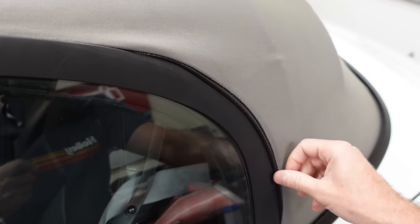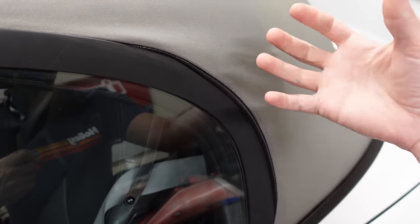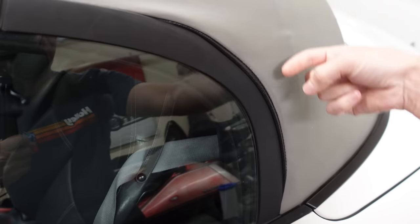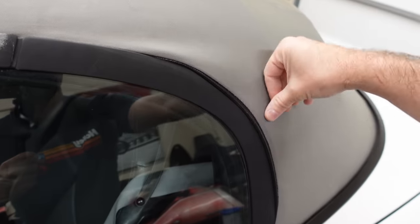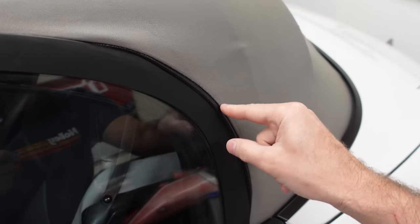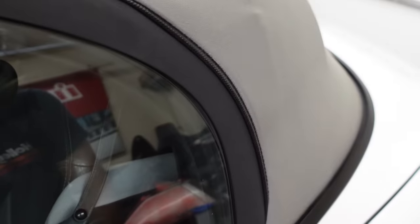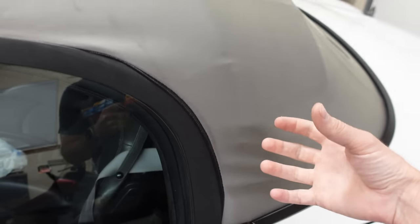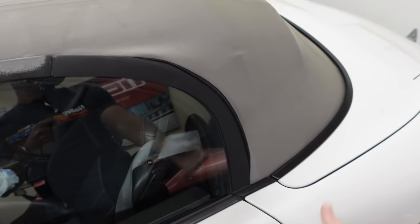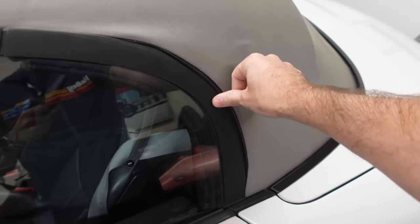But this should not come over it. This right here is a super reinforced — I assume it's a cable wrapped in rubber and stitched into the top — and it gives the top a lot of its tension. That's supposed to fall inside this channel. So if we open the top up, we can actually just push it over into it. You can see that it goes all the way up to there, so we are sticking way over that thing. It's supposed to sit inside it like it does down there. And you can see where eventually the top starts to wear out because it's being used. This one is honestly old, it's got some miles on it and it stops pulling this back into place.